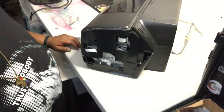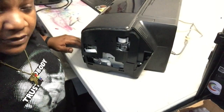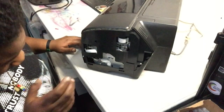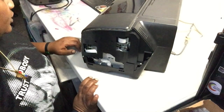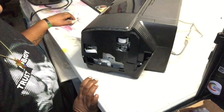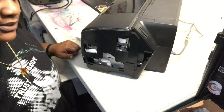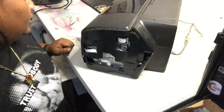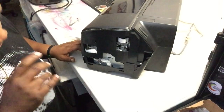I had somebody in my comments saying they had an issue with my sign-off phrase, so I told them thanks for watching. Anyway, when you first open the printer you're gonna see the waste line. The 1400 only has one waste line, which is cool. The 2880 has two waste lines. The 1400 is a six-color printer; the 2880 is an eight-color printer, but they both print up to 13 by 19. The more white channels you have, the faster the printer — so by that theory the 2880 should be faster.